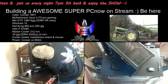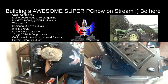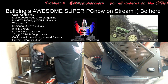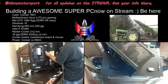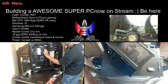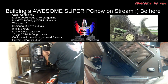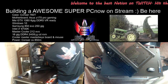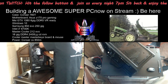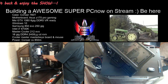This is the CPU power, which goes right here at the top of this motherboard. And that's locked into place. Push it in until it clicks and locks. This one will go right here. Hold your motherboard a little bit while pushing the big one in, because you want to make sure that you don't bend the motherboard. And that just locked into place. Now we've attached the power supply to the motherboard.